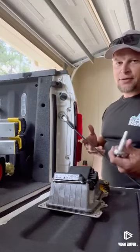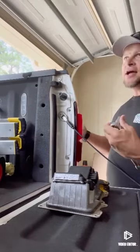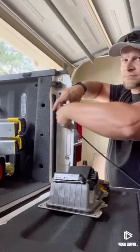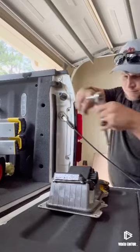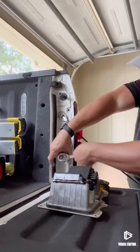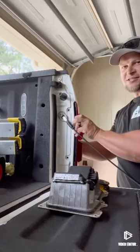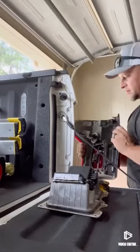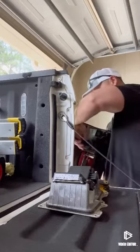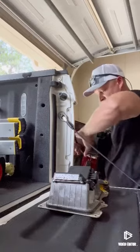On taking out a tail light, it's pretty simple. One bolt here, one bolt here. Pull it out, and then we'll just unclip it. Okay, got the bolts out. Just pull it straight out this way. Pull your plug out. Get it undone. Of course, it's gonna be ridiculous. It probably doesn't help that it's coated in dirt. There we go. Okay, that's basically it.